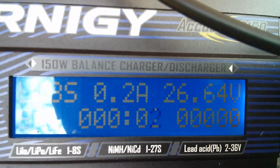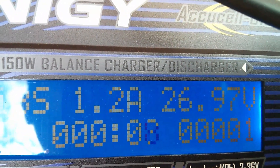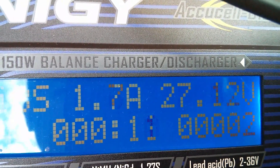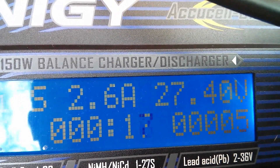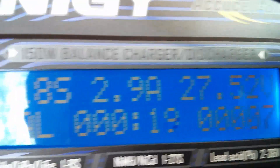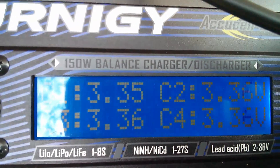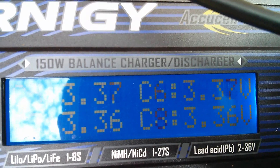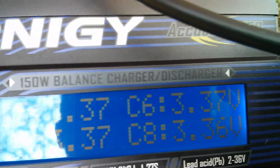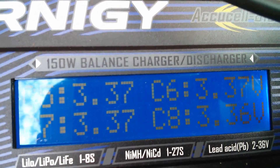Current is going up. The voltage is also going up, which you'd expect. The time is clocking up, and the amp hours — or milliamp hours I presume — that is on the bottom right. The fan has started. That all looks good. If I press it, it will show me all the cell voltages: 335, 336 across the board. Next page: 337, 337s and 6s. Well, they all look pretty well balanced, so it shouldn't have too much trouble with that.